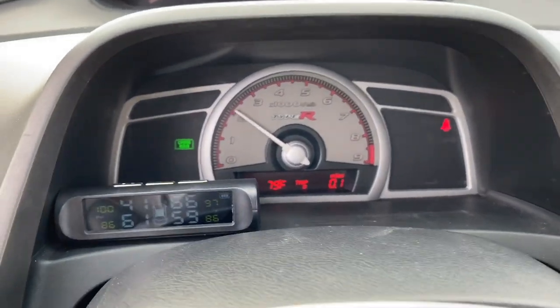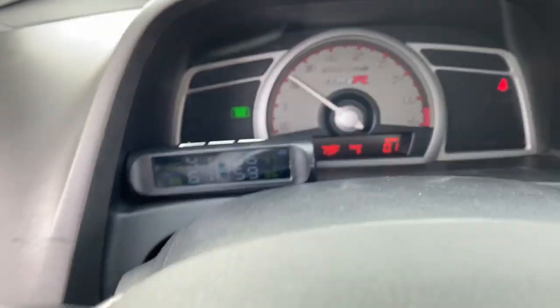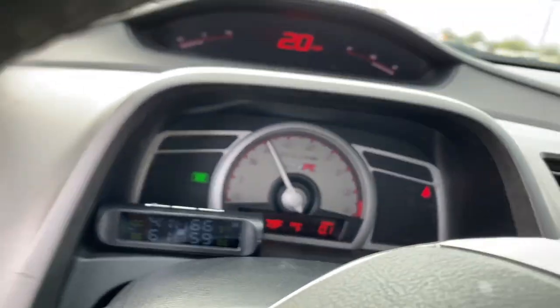I reset the odometer on trip B so we can see around how long the rear tires last before they have to be replaced after the flip. That way I can see exactly mileage-wise how long the tires last when I'm running negative 12 camber and my alignment isn't 100% - the toe is at 0.8, it was literally maxed out. I'm trying to work on a solution to get that down to like 0.1-0.2 within spec.